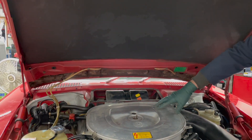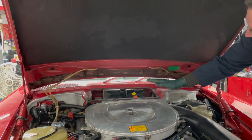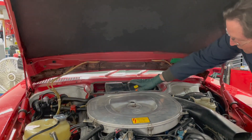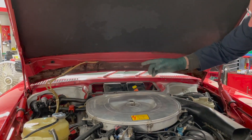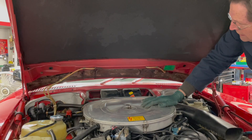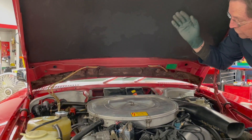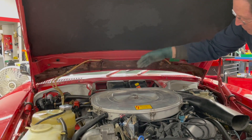Your head keeps banging into the hood, and if you're not careful, your head's going to bang into the grill shell. So the first thing I'm going to do before I start pulling out the blower motor is install my R107 hood extender. We call it the head saver — it'll raise the hood considerably so we'll be able to work in here much more easily.